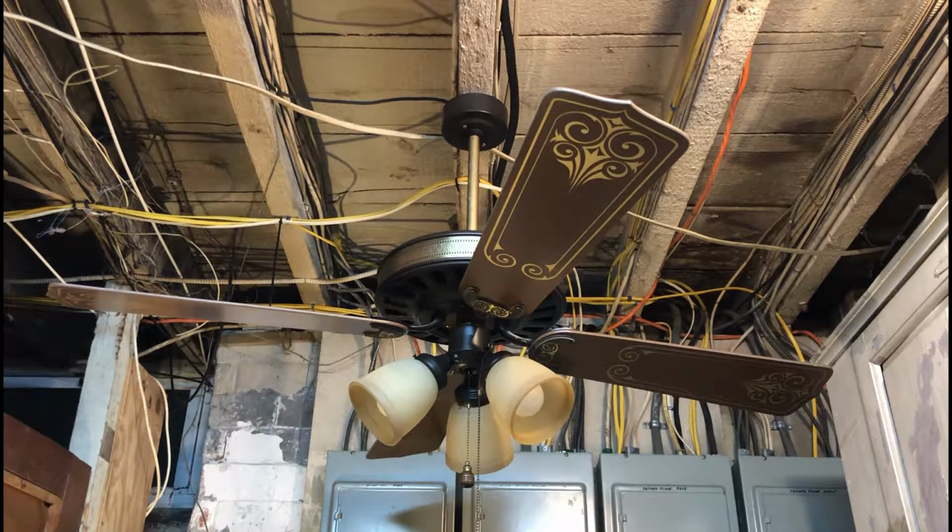So I had to open it up a little bit, and there were multiple brass slots inside the pull chain that rotate amongst the contacts, so I had to cut 2 of them out to have just one in place, so that just that one only does a direct one by one by one contact amongst all the speeds, since that's how the fan works.